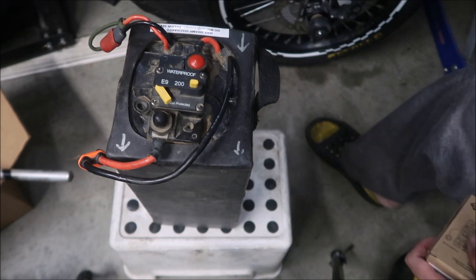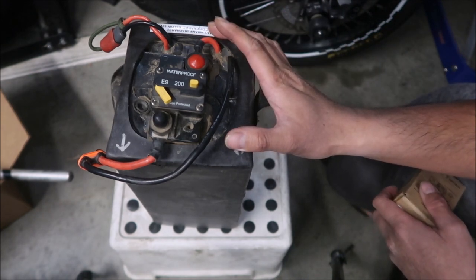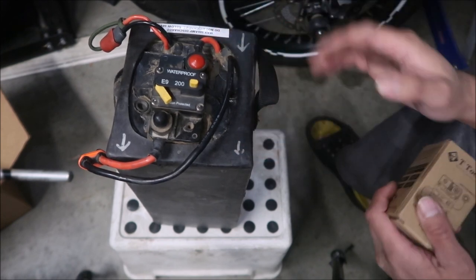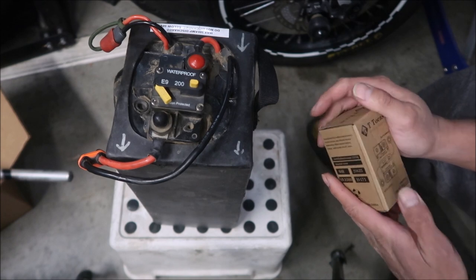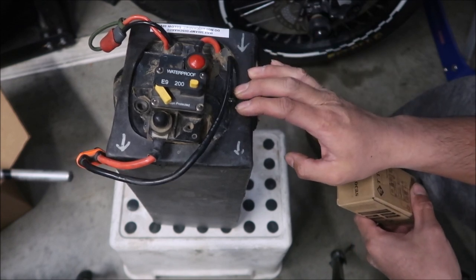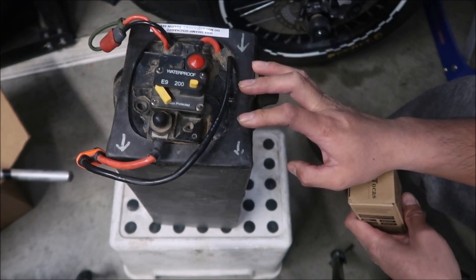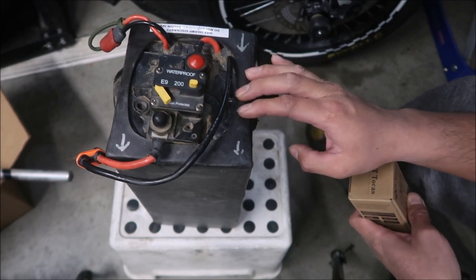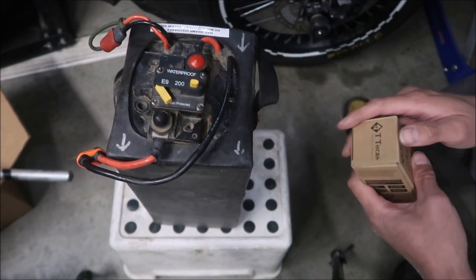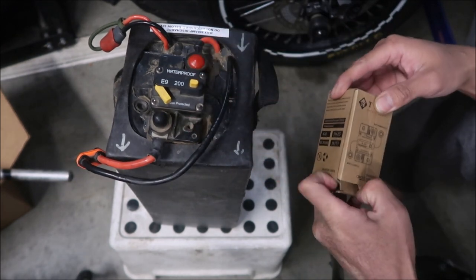This is my 30 amp-hour Lightspeed Bikes battery running on 18650 Sony BTC cells — very good cells, and they haven't gone bad yet. My other electric bike may have Panasonic cells, but I think the RPAC uses Sony BTC cells too — it's a very good battery. Here's the old breaker, and here's the new one we're going to replace it with. Hopefully this will solve the problem.